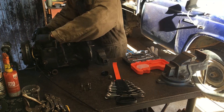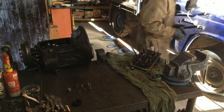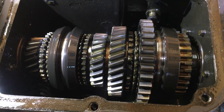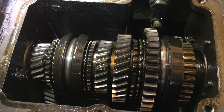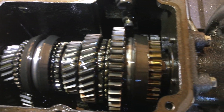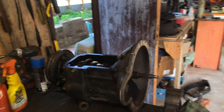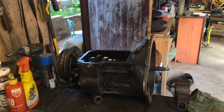So it's day five. Are we going to make it? I'm going to get the gearbox serviced a bit, pull apart the handbrake, then we can start putting it back in the vehicle. There's the top with the selectors. Down in the bottom I can see some little glistening, so I'm going to give it a little wash and replace the oil. Then we can work on the handbrake, which is at the back left there.